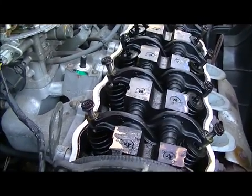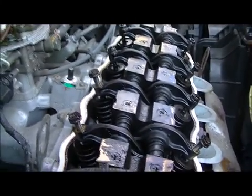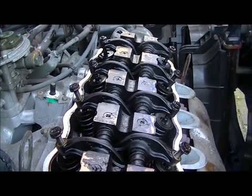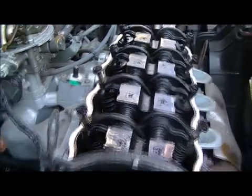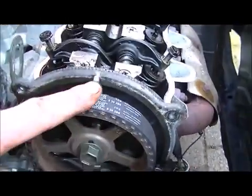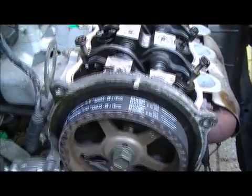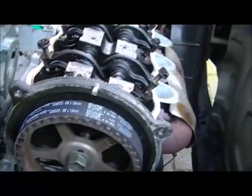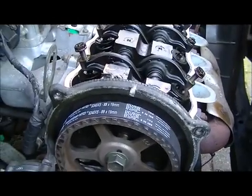The only thing that you really have to take care of is that the manual assumes that you have the crankshaft in this position, and not in the position with the camshaft mark pointing upwards. So at first I was mistakenly adjusting the wrong valves. Now I'm in good order.